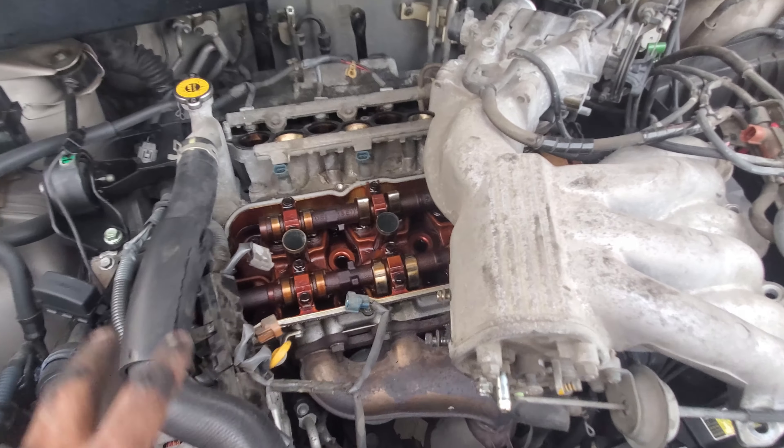That's the valve cover — it's pretty easy, except for the back one where you have to remove quite a bit of stuff. Like I told you, it's pretty easy to remove the manifold — just four bolts right here, then one bracket in the back with a 14 millimeter, and it should just come right out with the hoses. It took me about three to four hours, just because I was doing the spark plugs as well. Maybe you can do it faster, like two hours. Thanks for watching, see you guys next time.